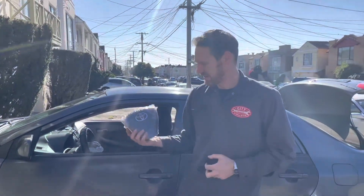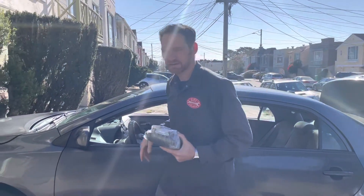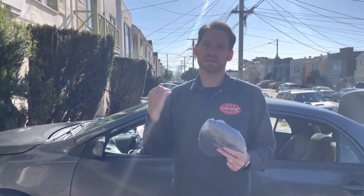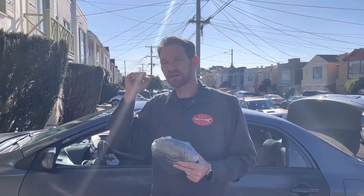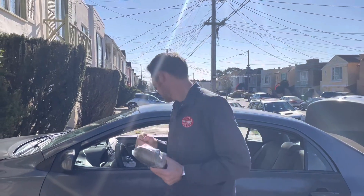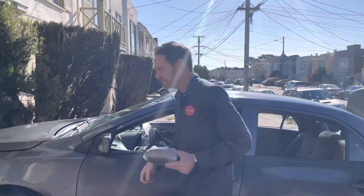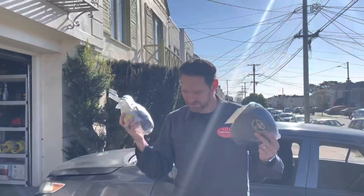2010 Corolla and we have to replace the airbag — you can see the airbag's deployed. A lot of people don't realize there's actually what's called a pre-tensioner in the seat belt — it's a little cap that fires off and sucks the seat belt down to tug you back into the seat. That's also gone off, which is why we also have a seat belt to replace. Here we go.